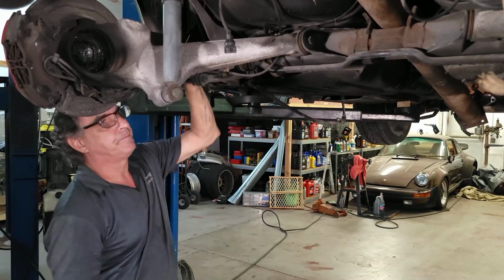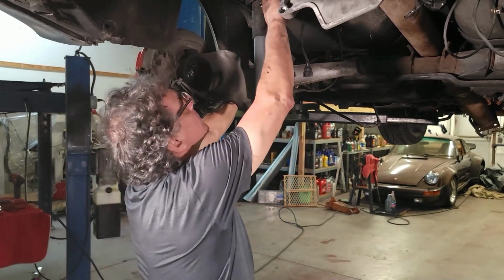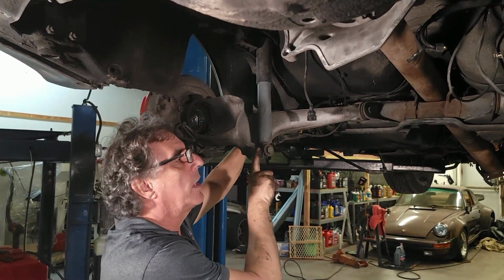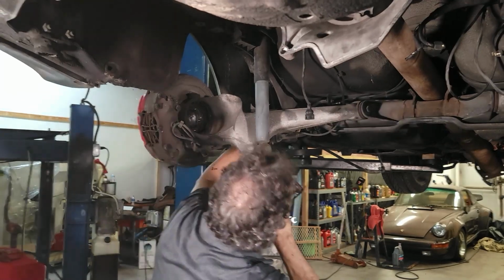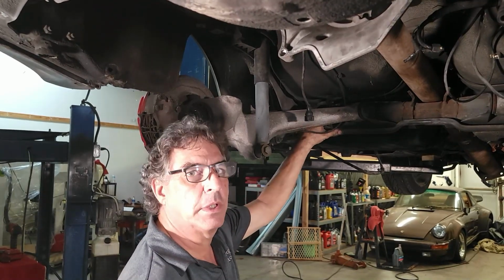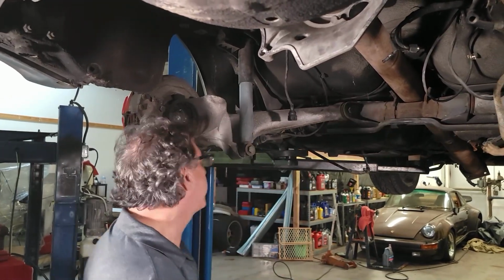All right. Now we're going to set this on, I'm going to take the nuts off of each shock so they're ready to come out, and I think I can leave these. I'm going to try to leave these here. Let's see. I'll have to pull the clips off the rubber brake lines, the flexible lines where they mount to the torsion bar frame. That's easy enough to do.